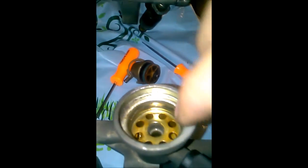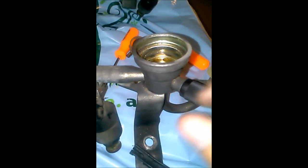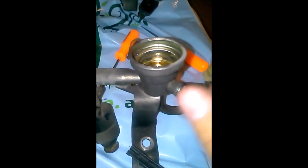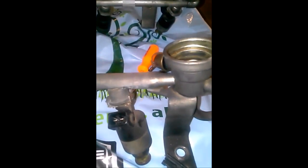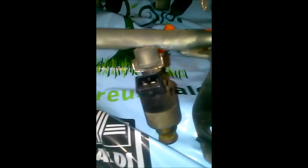Replace the snap ring under this lip right here. Make sure it's clean in there — this one has a lot of dirt and grime, so clean that out. Also, if you want to relieve your fuel pressure, there's a valve right here that looks like a bike tire valve. You're going to have to stand off to the side because there's pressure — press it in like a bike valve to release the pressure. Or you can just let your car sit, which is what we did.